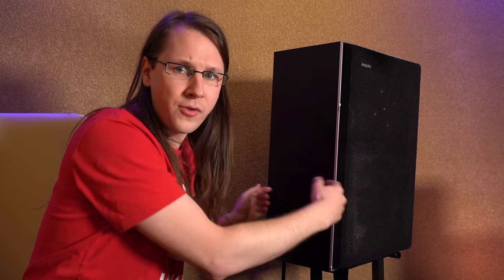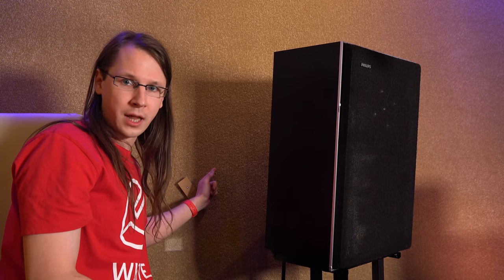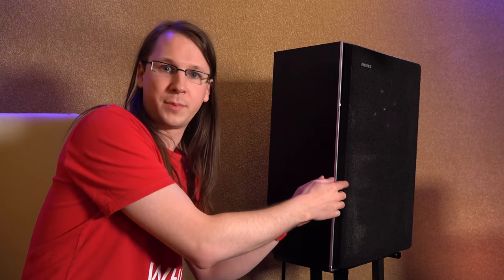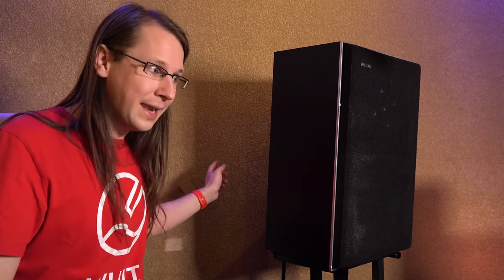So the sound isn't only going forward — it also goes around the speaker, all the way to the wall behind it. When it hits the wall, it bounces back and travels to my ears. Both signals depart from the front of the speaker at the exact same moment. The direct signal arrives at my ears first, and then a little bit later, the one bounced from the back wall arrives as well. This slight time delay creates a phase problem. Let me try to illustrate how this looks.